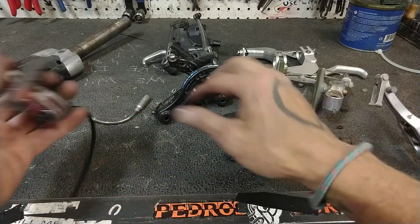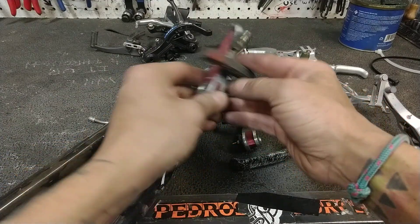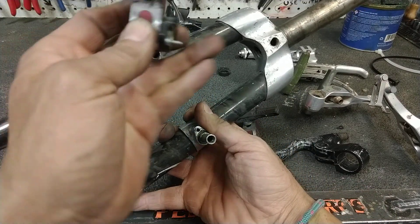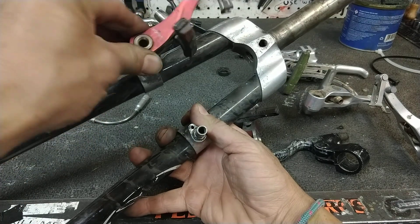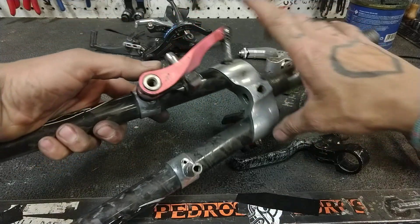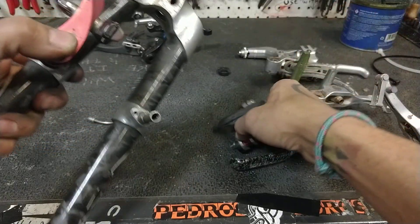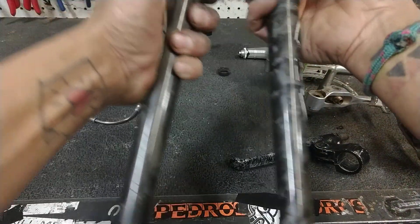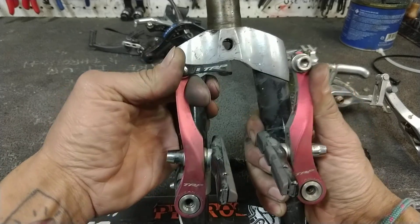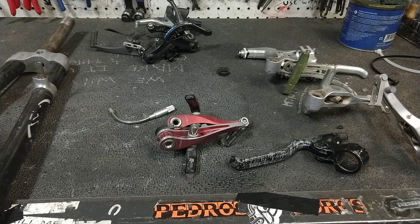With all of these brakes, you have your fork or frame. There are small receiver holes for the springs — there's a spring pin there, you can see. These slot into the holes over the posts, and the spring imparts return tension to the brake. Put them on both sides. Cable pulls, brake closes. Less noise, more power. One of the best designs of all time.